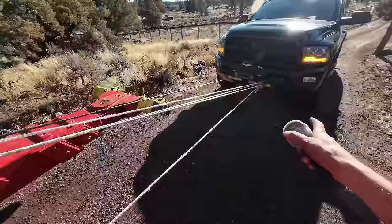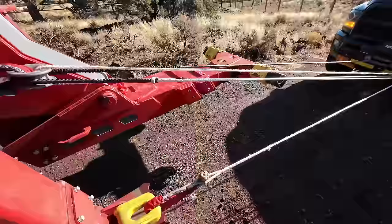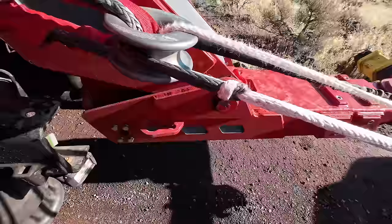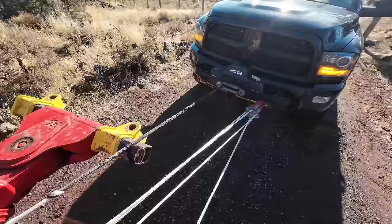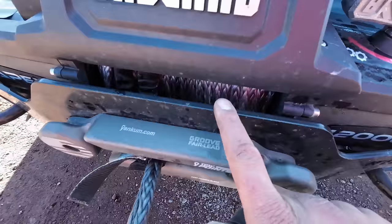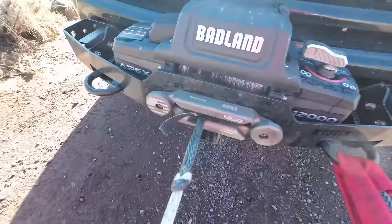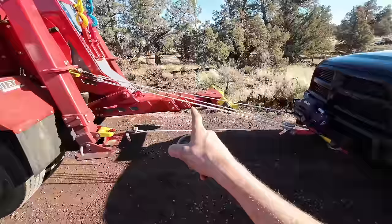Okay, back up and rolling. I know that was one really long take — probably terrible for audience retention — but I didn't want anyone to say there was any trickery. We already have enough of that by switching trucks. Here we go back up to the outside of the upper ring, right around the outside beautifully, out the other end, and now this is my actual winch line — we run it all the way in to the winch itself. Look at that — spooled up beautifully, all the way across the drum. We were able to pull it all the way in from down there using the extension and a five-part line that we never would have been able to reach with just the drum on its own, and we didn't have to stop and disconnect and reconnect our pulley points.